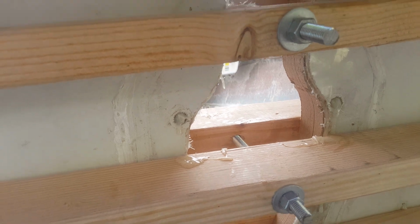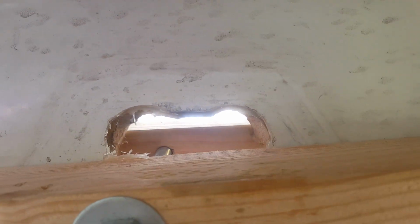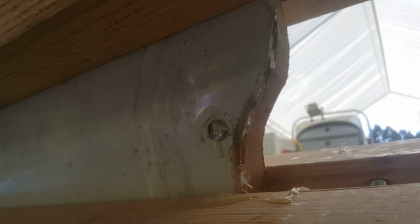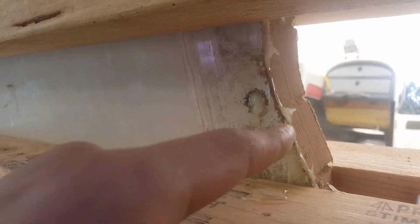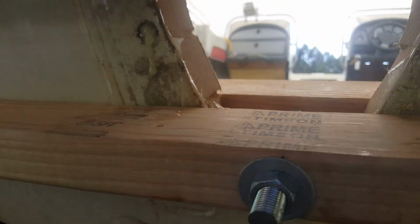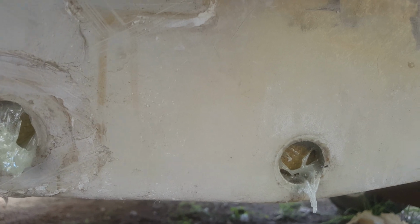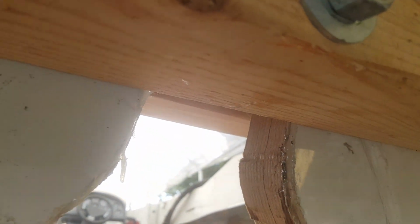Okay, so we're in the back of the boat. If you're wondering if we got good coverage, the easiest way is to do a 360-degree view all the way around where you started clamping, and you should start seeing it ooze all the way around. We got plenty of ooze out of where the live well was, where the drain is. Around there is good. Good all the way around. So that means we got a good squeeze on it.